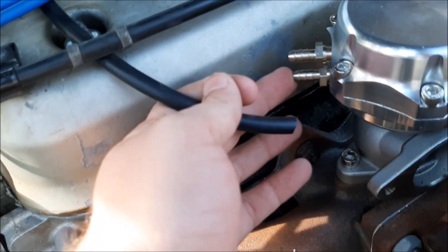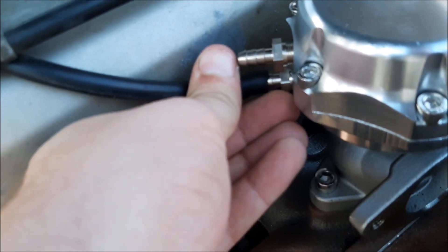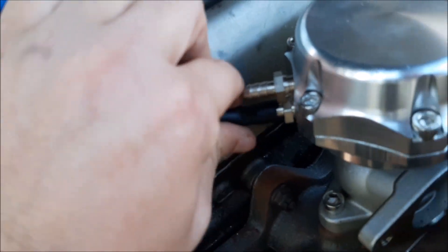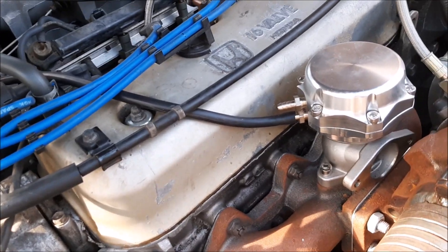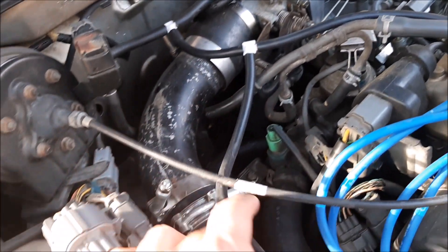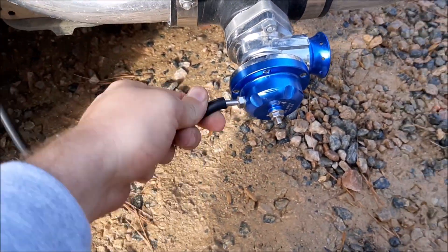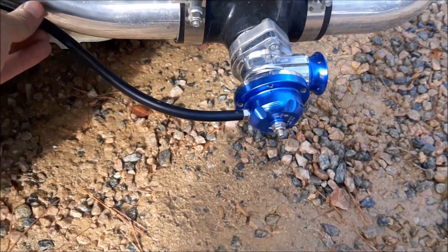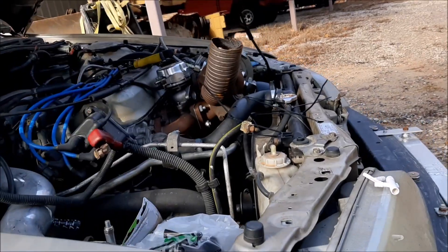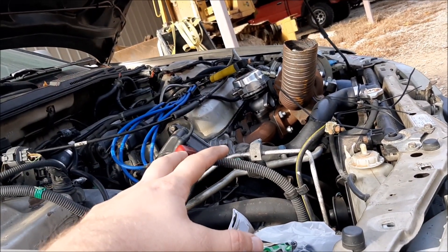When using a wastegate and you just want to run off wastegate signal, you always go to the bottom port, not the top. I'll put some zip ties around all those connections because if that pops off you're definitely over-boosting. Our vacuum signal comes down, tees off right here going down to the wastegate, and then another tee goes down and out to the blow-off valve. I like to zip tie all the fittings to keep them extra tight so we don't have any vacuum leaks or boost leaks under boost.